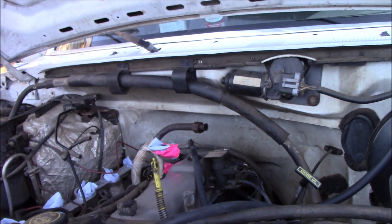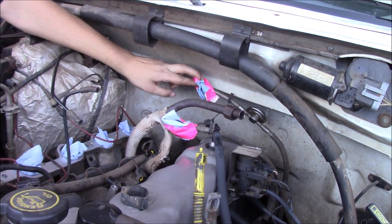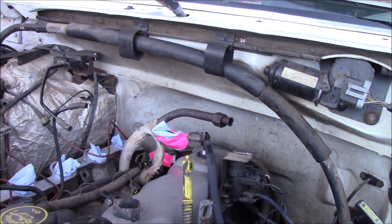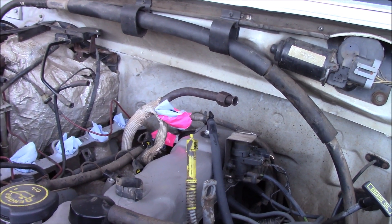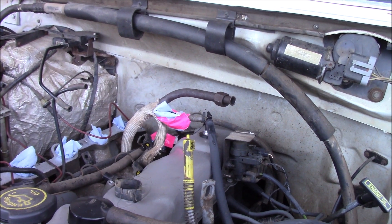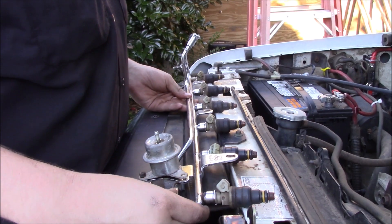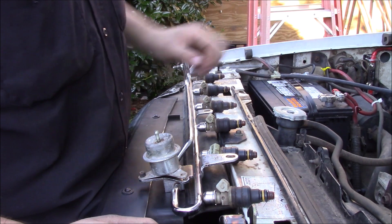So, whenever my dad turned on the ignition, it sent fuel through it and soaked the rag I had covering up the two lines coming in. That thing soaked in fuel. He turned on the ignition and it primed — I was wondering because I got a really strong gassy smell when I got over here. Now we know it's in the fuel lines. It hadn't been a problem — it's just not running good.